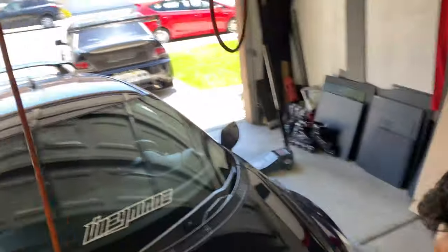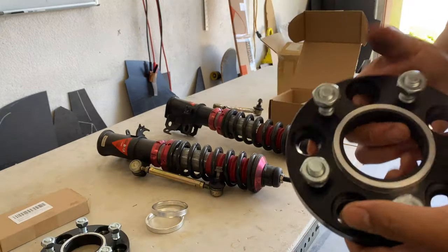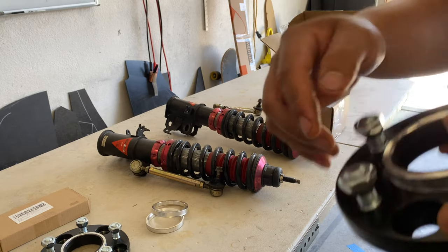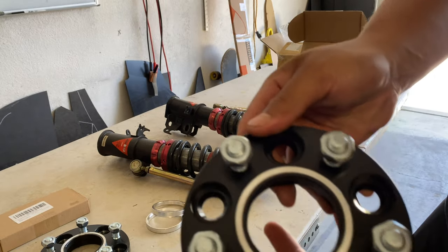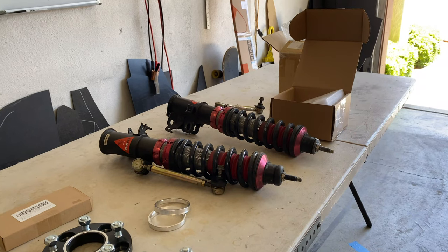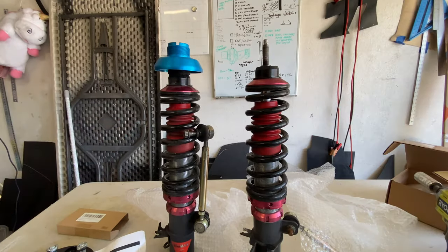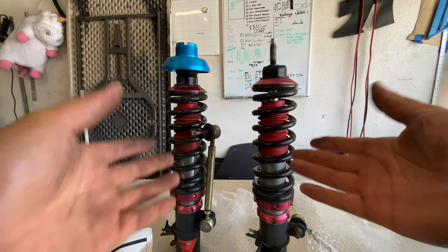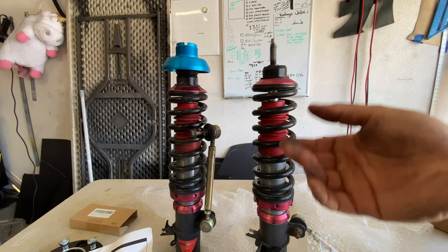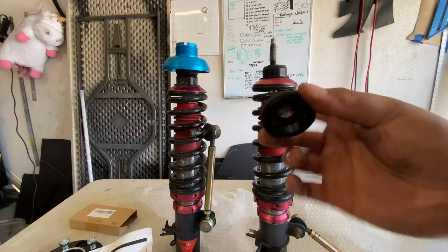Let's move over to this table and I'll show you guys what I'm installing today. We got these coils — these are Godspeed Mono Maxes. I'm also going to be installing these spacers; they're 15s, but I'm going to be adding five millimeters in the back because they were too long. That'll make them 20mm, and I don't think 20mm spacers will rub. So we have spacers, front struts, and these Cusco solid front pillow ball bushings. These coils are just temporary — I'll be swapping them out once I get my BCs rebuilt, because I actually want to run a cup kit in the future.